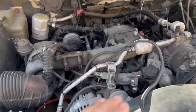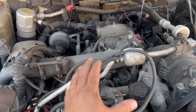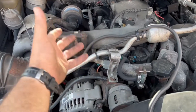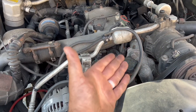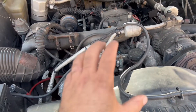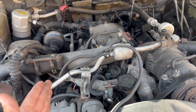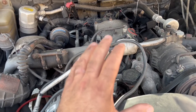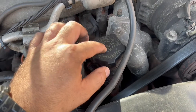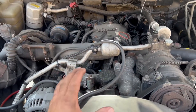The third thing is engine oil. You have to stay on top of it — maybe every week, whatever your routine is, get under the hood and check your fluids. Make sure everything is at the right level: your transmission fluid and your engine oil. Use the proper oil. Don't use weird blends — just go with the normal stuff. This engine calls for 15W40 oil, and that's what I always use.